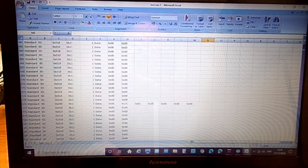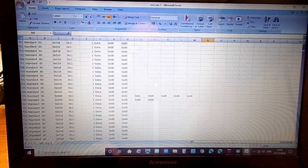The software ran on the Arduino to collect the data. Basically there are four messages — I can find four IDs: 0x518, 0x519, 0x540, and 0x550. I've worked out so far that 0x518 is the RPM and 0x519 is miles per hour.